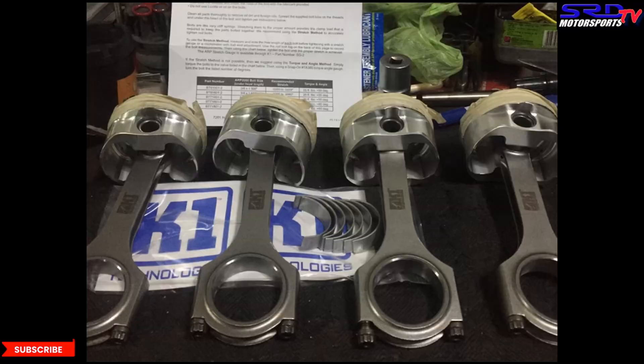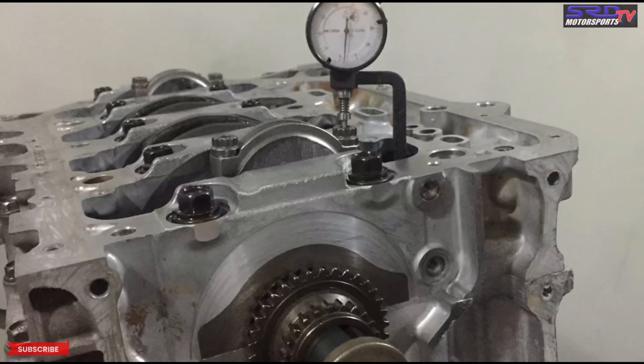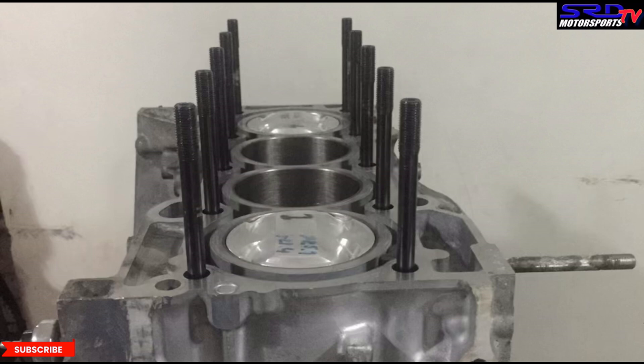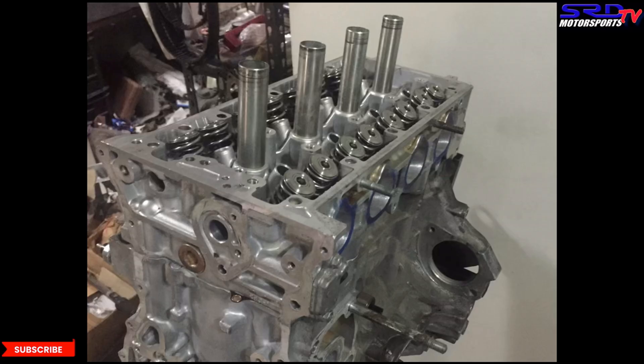Back to the rods and pistons — it's ready. We taped the piston rings so they're safe and we install them. After installing the pistons, we stretch the rod bolts with a stretch gauge — a link explaining that will be in the description below. Now the ARP head studs go in for durability — this is a street car so durability is not optional. A Super Tech valve train completes it.